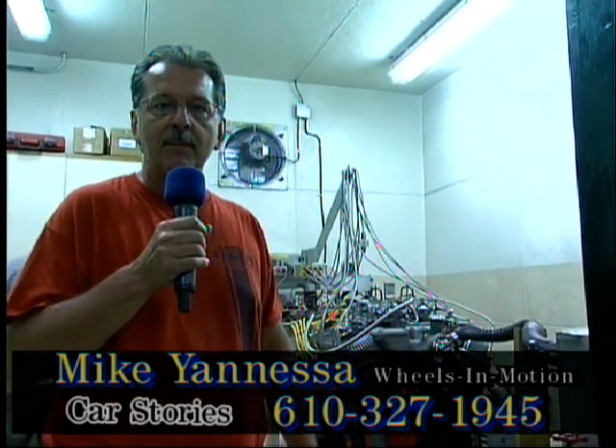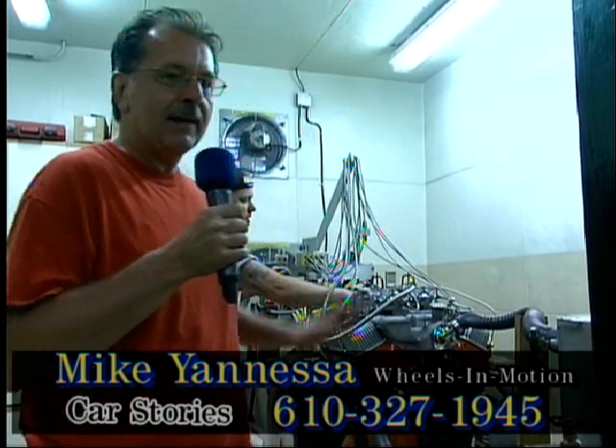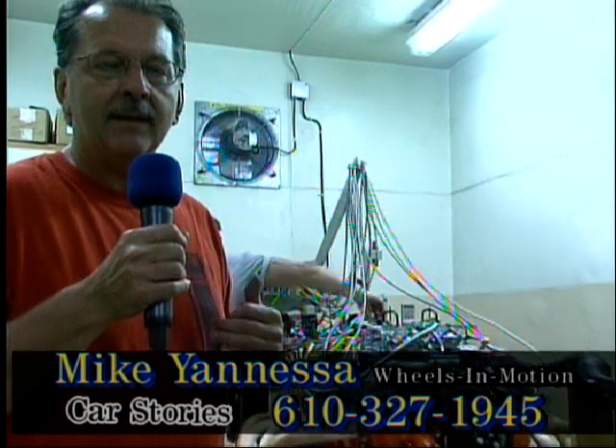We just made another jet change because it liked the first one — we're giving it even more fuel. We're up to 74s in the primary jet and 83s in the rear jet. This 327 is being built for my race car, Big Red. Big Red was on the show several times. It was my wife's first car when she was 15. It was my first frame-up restoration in 1985 — I restored the car just about all by myself with the help of my father. Ed Quay Race Cars did the roll bar and Larry Roberts did the motor way back in 1985.